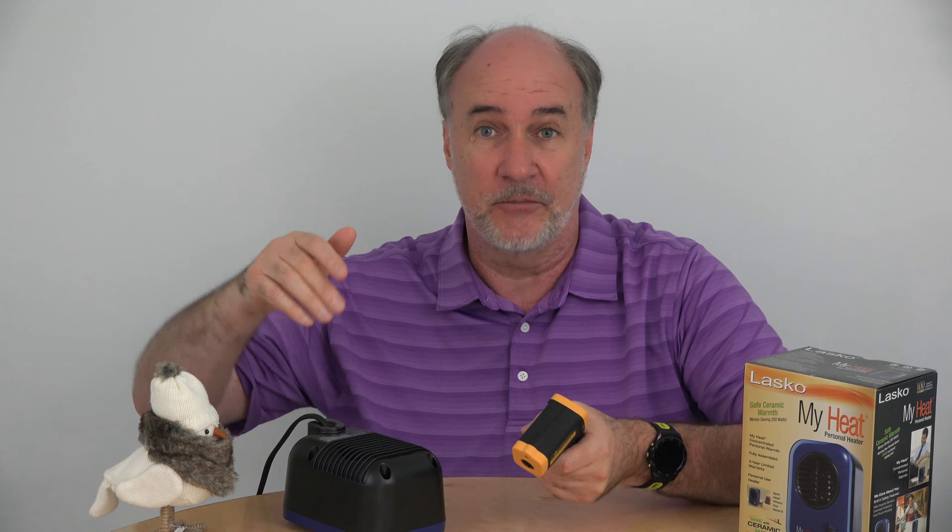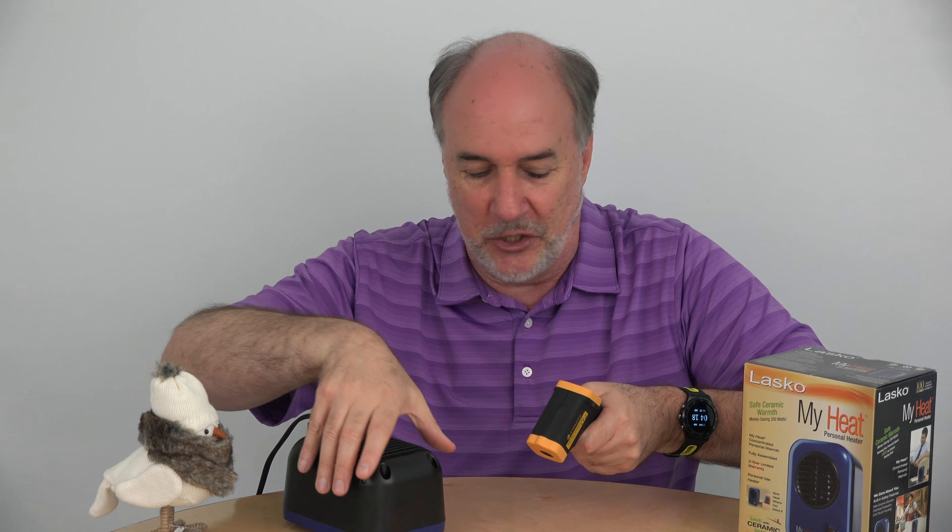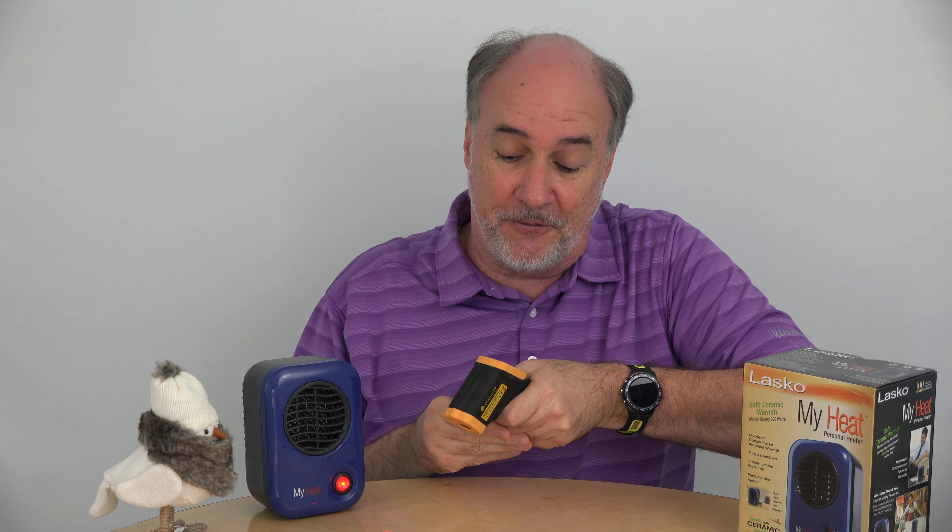Let's see whether it shuts itself off from overheating after one minute. If not, I'll pop it back up and use my infrared thermometer to see the temperature of the table right where that heat's been blowing — it's about 75 degrees normally, which is reasonable. It's been one minute. Still going. Smells warm. I think the fact that it's on a hard surface means enough air is escaping out the sides that the temperature isn't raising enough to shut it off, at least not yet. Worst case scenario would be a thick carpet, towel, or blanket. The temperature right there is reading 149 — 145. Toasty.